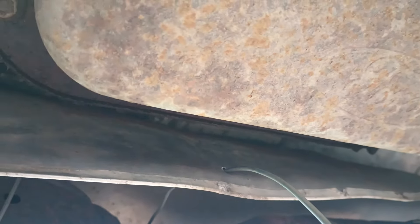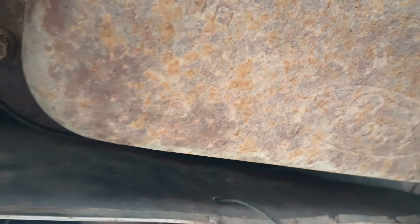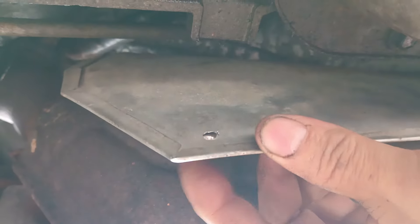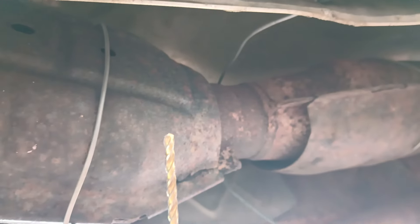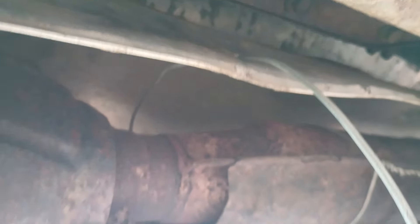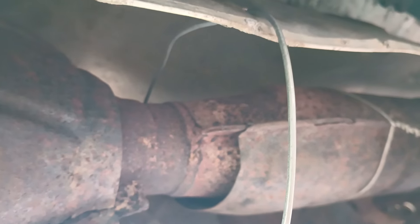You can't easily take it out because some of the screws are still okay, but you do need the heat shield to avoid heat passing to other components. So all I'm doing is drilling some holes here using an angle drill — very easy — drilling some holes on the heat shield and then putting a wire to wrap around and fasten to whatever you can tighten it to.